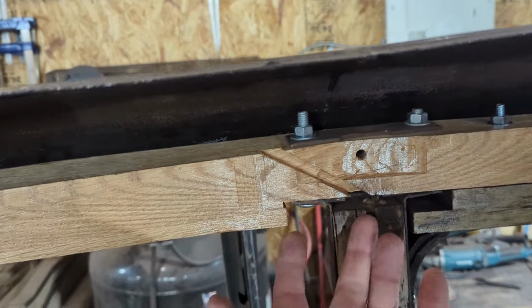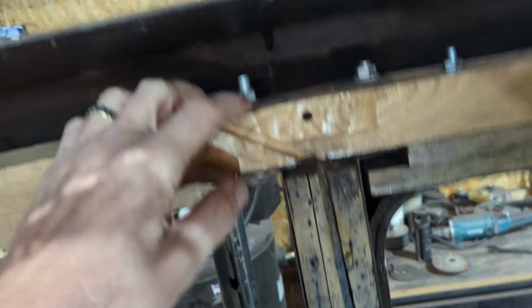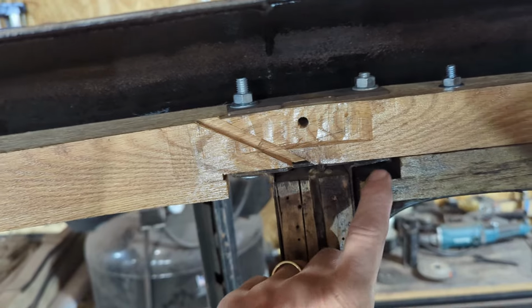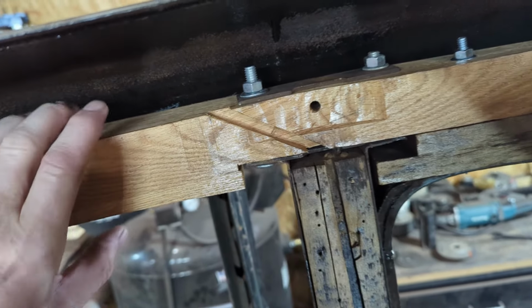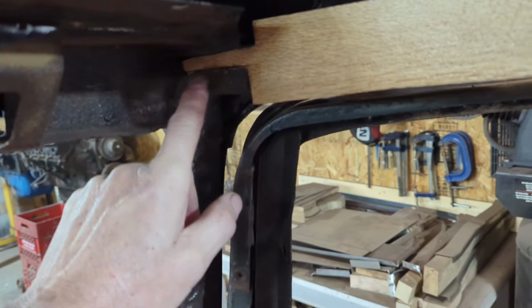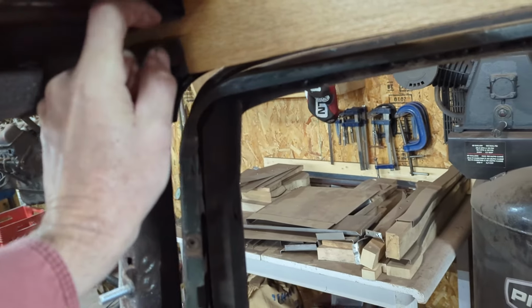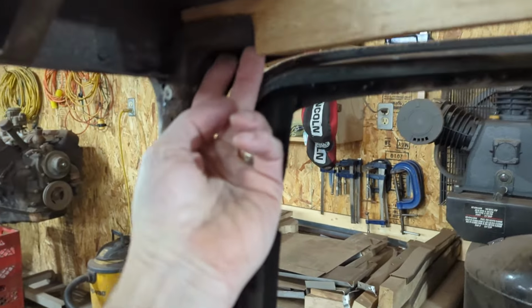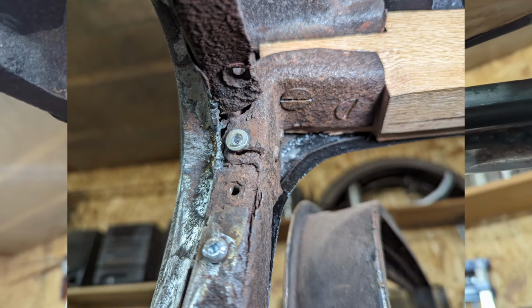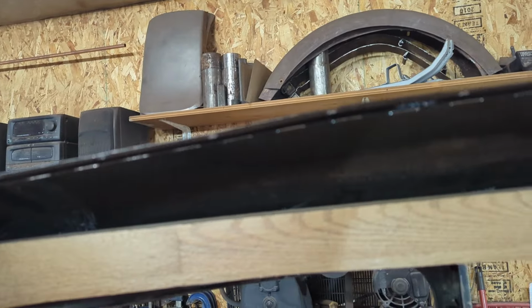So there's two bolts that go up. They're carriage bolts that go up through the B pillar and meet into the top. And on the top of it, I think you can see here, there's a little plate. You kind of have to get this bolt in first, get this fit loosely in. The other thing in the front here where it goes into the cowl, a lot of times when you buy the aftermarket wood or you make them yourself, you've got to trim this so that it fits in there nice and tight. And then there's two screws. I don't know if we can see them or not, but right there, they go up through and go into place. So when you're fitting this, don't put those in.